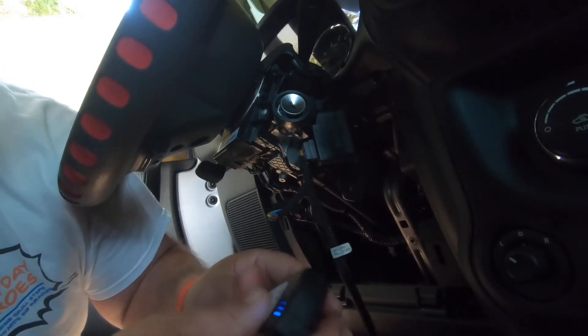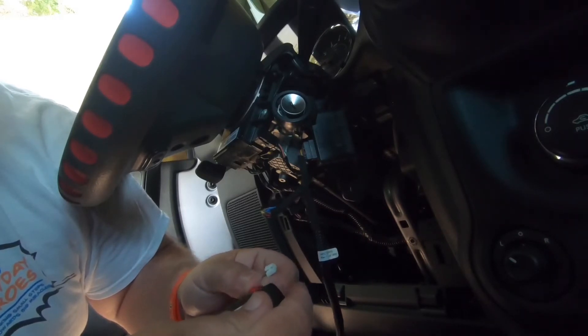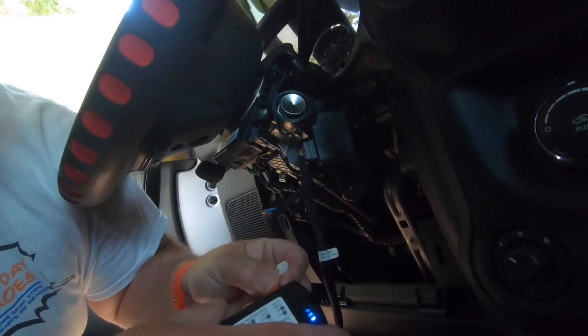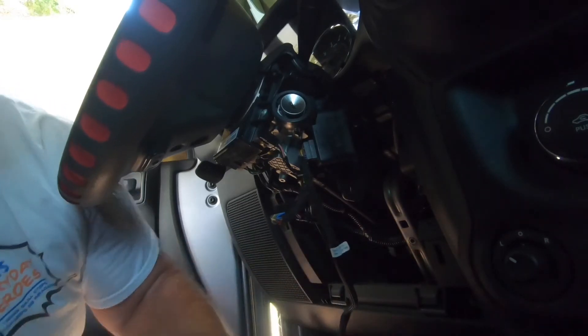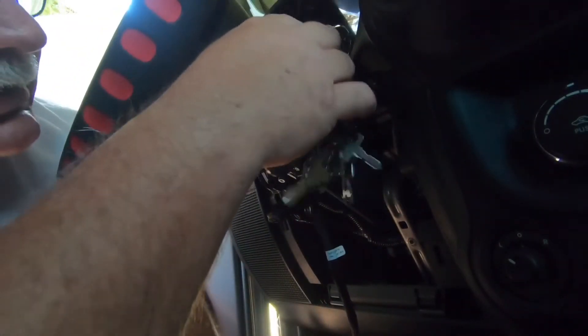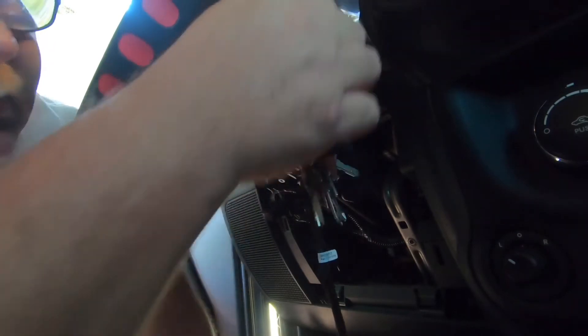Go with your 20-pin, then your red connector, then the white one — this is just the order I saw on a video, which is why I'm following it. We're plugged in. Now you want to take your ignition key, put it in two clicks — do not crank it — just two clicks.